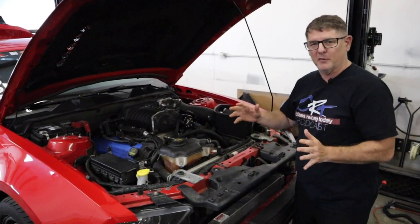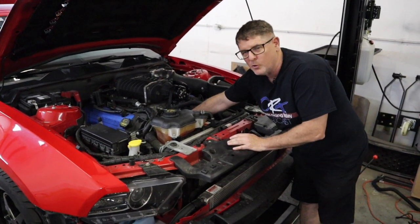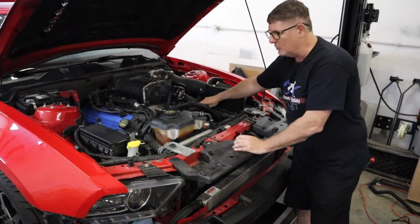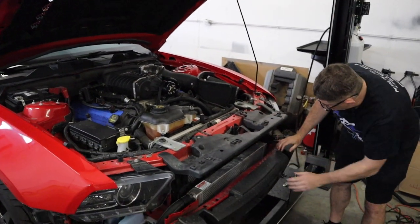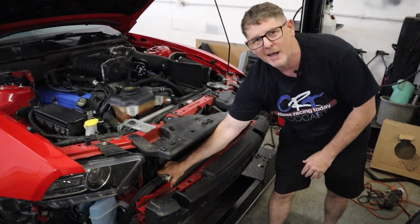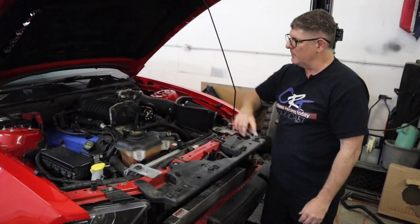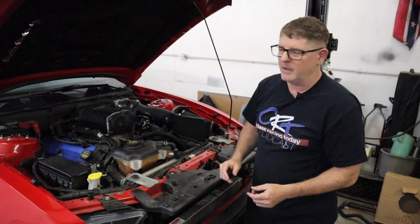So we got the pump running, we filled the tank with ice, and our lower hose over here should be really cold — and it's freezing cold. This hose is really cold. It's actually cold coming out, of course, because the engine's not running, but this will have ice water going through it and it's going to cool the intake charge down a lot. Our heat exchanger here — this is freaking cold and everything's cold on it now. This won't be as cold when it's running because it'll have already come through the system, but this will give it another opportunity to get some heat out of the water before it makes it back to the tank. If this is a race car, you could delete this, but being a street car, we're going to leave it in there.